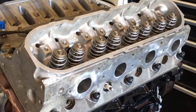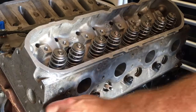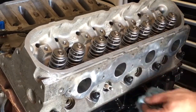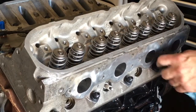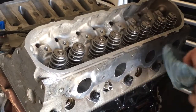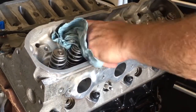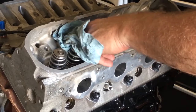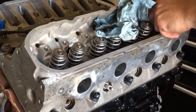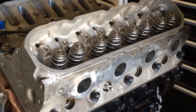What I like to do — just personal preference — is I wipe some of this assembly lube off because I don't like getting it on me. It's like liquid graphite; you get that stuff on you and it's almost impossible to get off, it multiplies on you. I personally don't like having that graphite-style moly in my engine oil even on startup, because it can make you think you have a bearing problem.